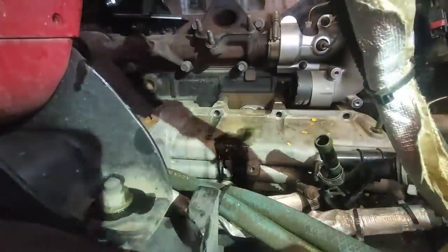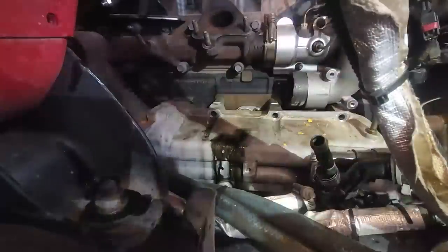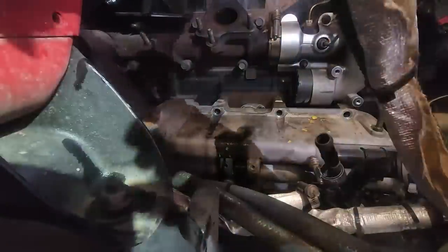Next is trying to get this enormous EGR cooler out of here. I got all the bolts I could see out and tried to see if it would separate, but it did not. There must be some bolts I can't see or some fitting holding this sucker on. So I got my mirror and found a couple on the bottom. Here they are - real easy to get to. Not really. They're actually so long they hit the frame. You can't even get them out or in if it's in the chassis. Brilliant design from the manufacturer who made both the engine and the frame.